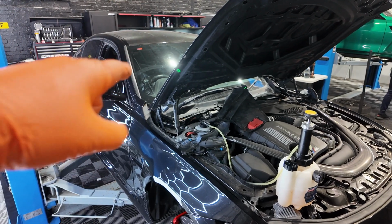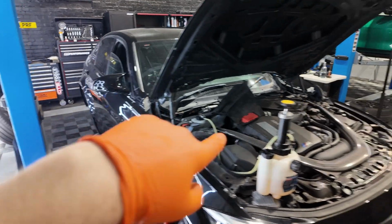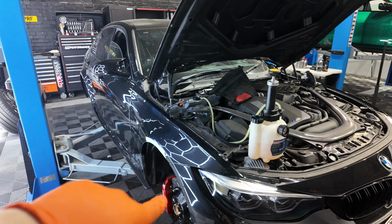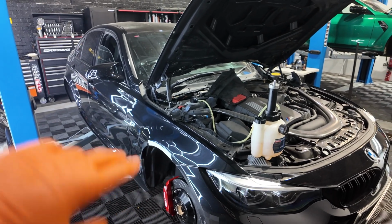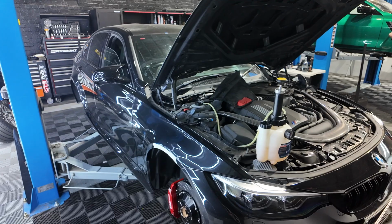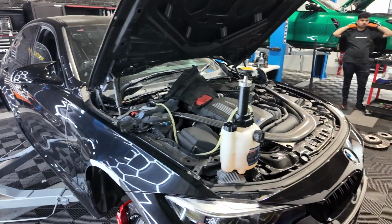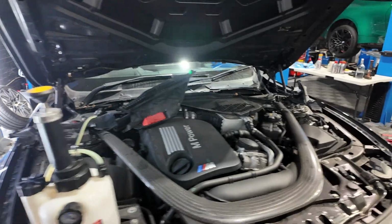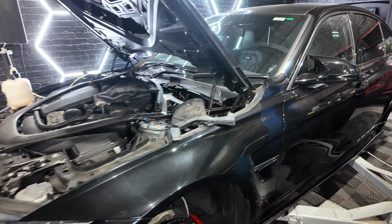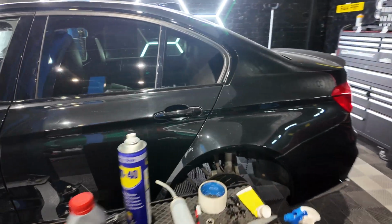We're going to bleed it until we get enough of the air out. We're then going to go to this corner, then this corner, this corner. That's going to get most of the air out. We're going to start getting a constant feed, and then we're going to go back to this corner, back to this corner, back to this corner, back to this corner, and do it all again until we get absolutely golden molten fluid and no air bubbles. It's not a bubble bath. So let's see what we can do, and then it's wrapping up suspension, and then we head to geometry.